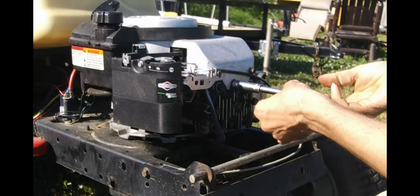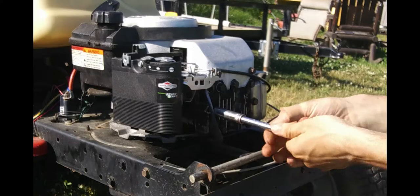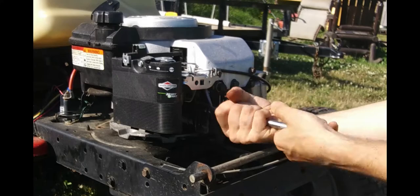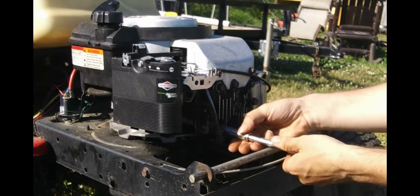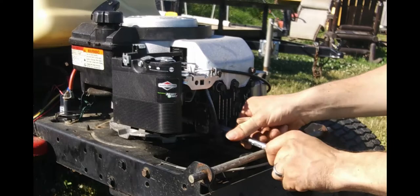One of the things you can run into when you shave these heads is that the valves or piston can make contact with the head because you're losing clearance. I actually haven't checked to see if that's the case — I just kind of milled that off for fun because it was a spare head I didn't care about. First thing I did was mill the fins off flat — these shiny parts here — so that it would sit on my mill's table flat when I flipped it upside down. The backside is a flat machined surface, so bolting the flat side down to the mill table works perfectly fine.